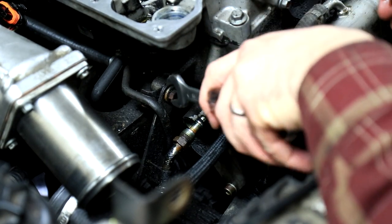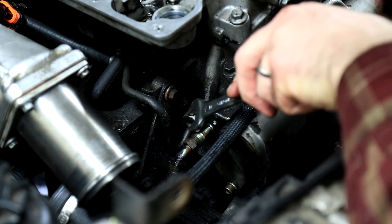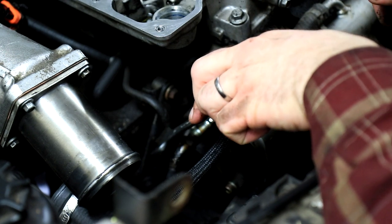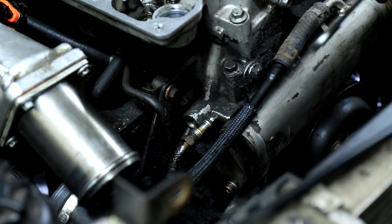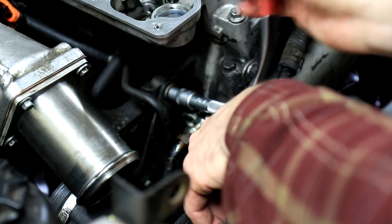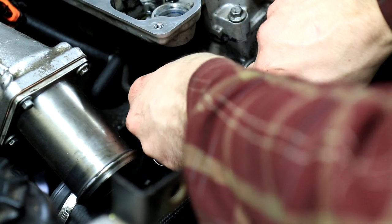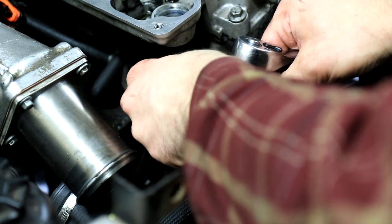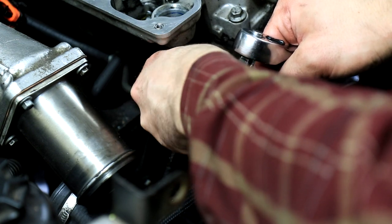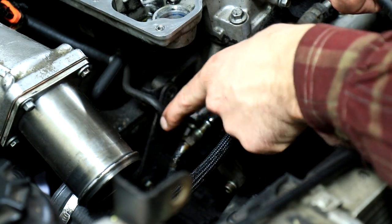And then when we're here, we are going to take off the alternator bracket bolt, the top and bottom. And you're supposed to loosen the bottom one, so you can actually move the bracket and take this one out completely. There we go, that's loose. Because it is fitted to the head, and we have to take off everything that's connected to the head that stays in the engine bay when we lift the head off. Okay, so that's off, and because I've loosened it down there, you can actually move it around.